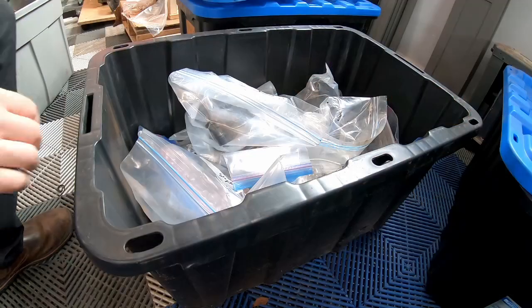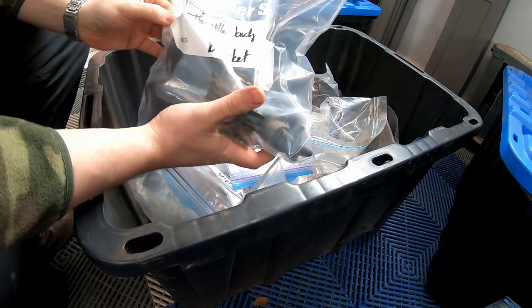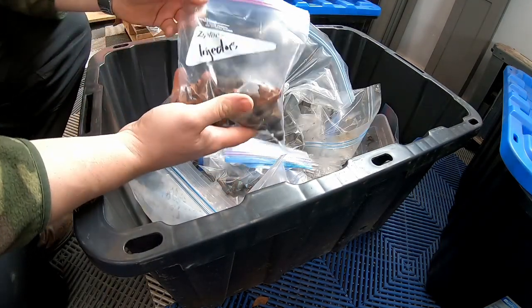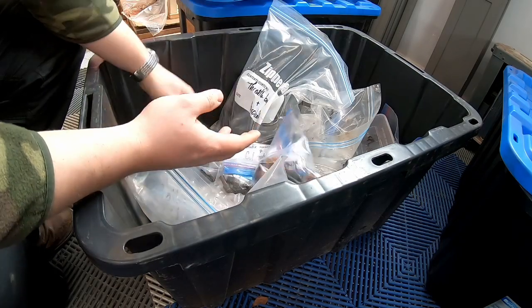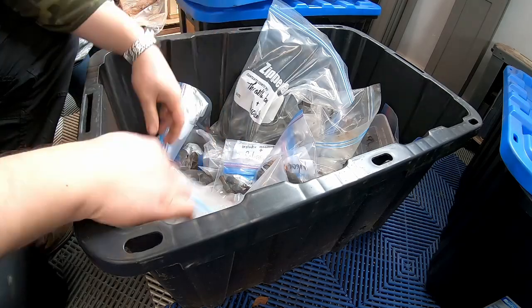I haven't talked about it yet on the videos, even though it's been going on in the background. First of all, as I was taking the vehicle apart, you may have noticed I always take every single bolt out, every single part. I label it, I bag it if it'll fit into a bag, and then I put it into a Tupperware bin that's also labeled. So engine, chassis, interior, and so on. When I do that, I take a look at each part and decide whether or not that part is suitable to go back in or not.